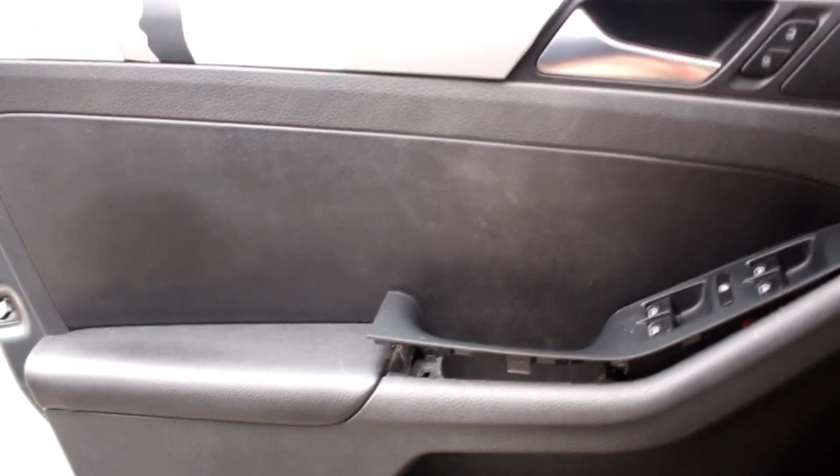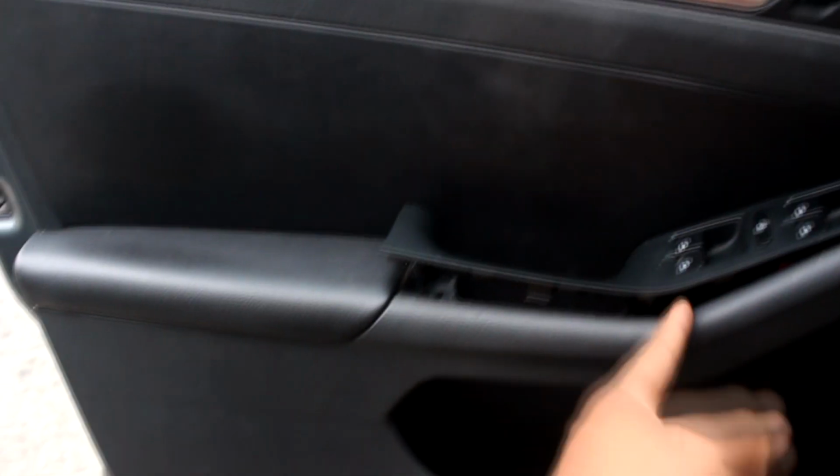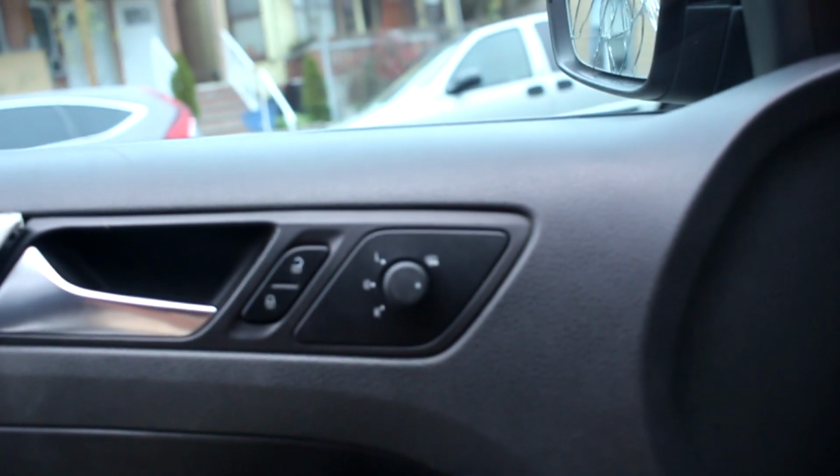Alright, so there's a couple of screws in the door. There's one behind this racy thing that I did, that I regret doing. There's one in here. You gotta pry this open and unplug it right there. There's one in here. You also have to pry open a little bracket, and then there's one underneath here. You'll feel it when you get there. It's right here. I'll put the screw size in the description. I'm gonna half-ass this because I don't want to take this whole door off just to change this. So I'm gonna try to pull this back enough to pry this open and unscrew the screw that goes right there and take it out. Simple. Oh, and unplug the actual mirror.